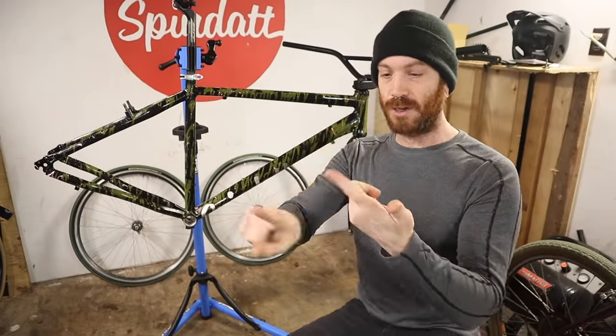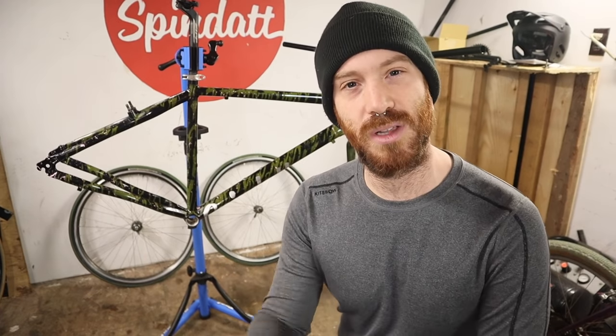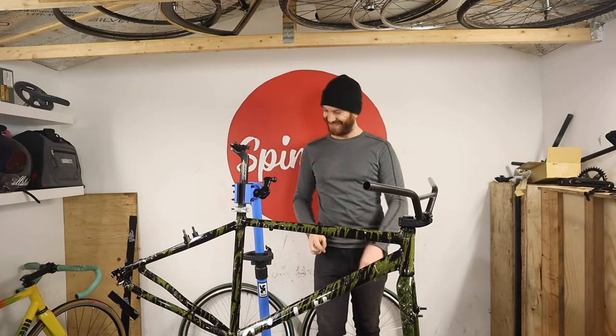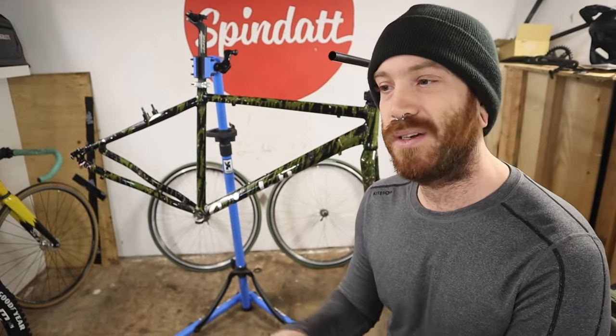Hence its name: the motivator. As you can see, the paint on the motivator is done — clear coated, wet sanded, polished and waxed. It's real smooth, except for the odd area where I did break through the clear coat, because when you add so many layers of paint on top of one another, even two cans of 2K clear coat can't make a thick enough coat to not burn through at some spots. Making this happen was a full weekend of thrashing on the trash for the bash, and I'm pretty happy with the finished result. Basically all that's left is to bolt all the stuff onto it, find out what little things I might be missing, and then compromise on other things because I've run out of money.